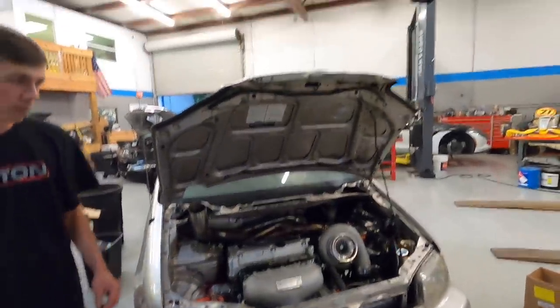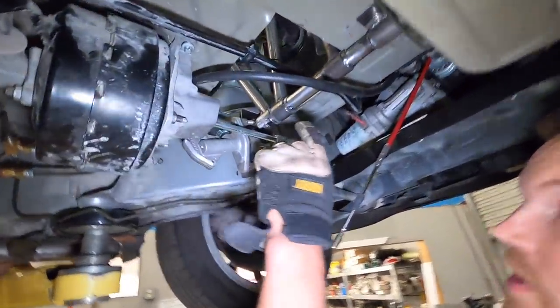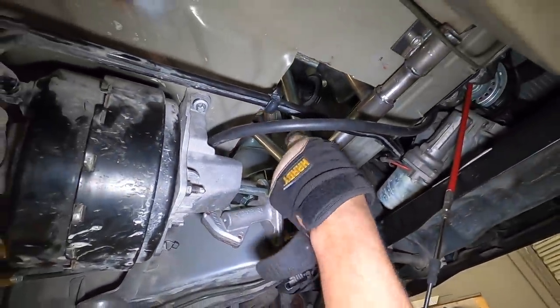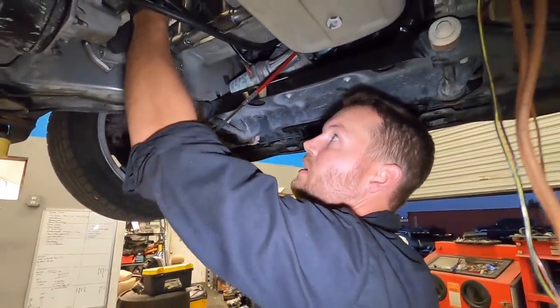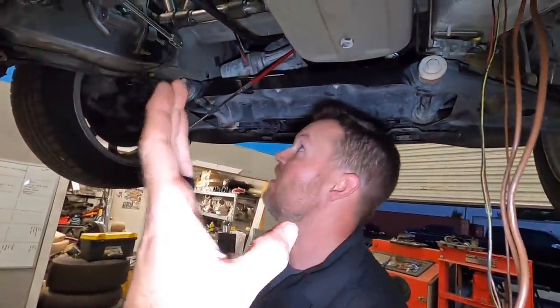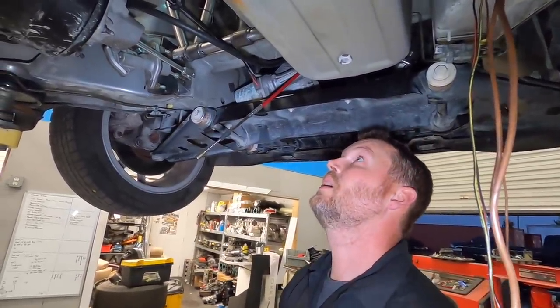But in the meantime, we're very, very close on this thing, and Laz is finishing up all the brake stuff, so that's what all this ugliness was right there. So if you look up, what I had to do is get the pedals in the right orientation. I see. I'm actually going to bring this one home tonight, and I have a bender, and I'll just throw a bend in that, but it clears the frame rail. Yeah, exactly. Right now it's way out there, but I'll get it proportionate to that.